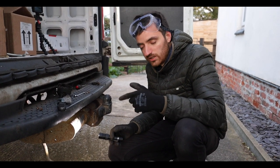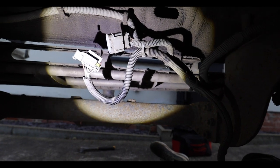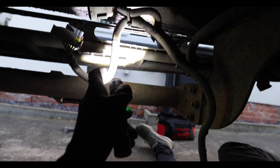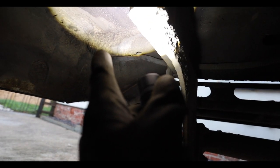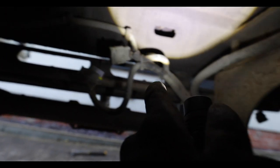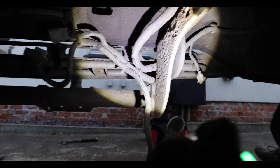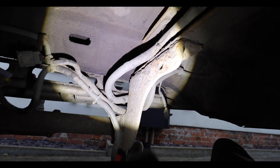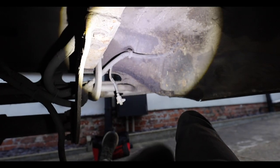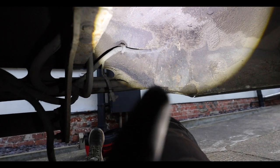I think I'm going to have to take both lights off and see where the wiring goes. So following it with a torch while laying down — there's the connector from the outside that I just disconnected, and all the cables run together. One runs into the light cluster on this side and the other goes into the light cluster on the other side. The main cable then runs all the way to the front of the van. I've disconnected that and removed the electric bit on the tow bar.